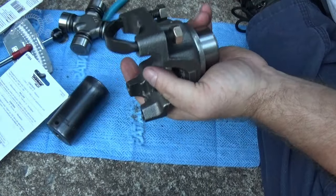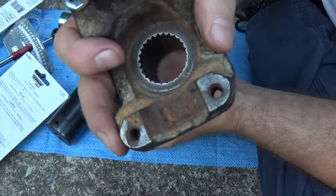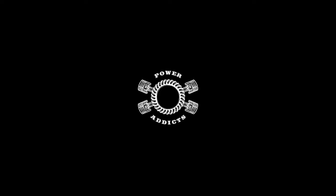So now I've got to get that U-bolt yoke in there because I just completed a video about the difference between strap style versus U-bolt style - if you want to watch that video go check it out. Hope you guys got some good information on setting up a pinion gear. You got to see that you got to do pinion preload and you also got to do pinion depth. Also in the ring gear video released after this one you'll also see how to change that pinion depth and how it affects the ring gear. We paint the gears with yellow paint - it shows where the rub is. If you guys enjoy these videos hit me a thumbs up, subscribe if you haven't, leave comments down below. I appreciate you hanging out. Peace, later y'all.